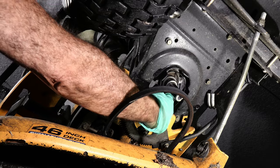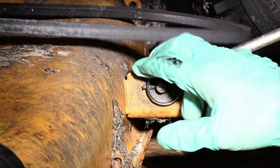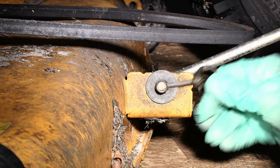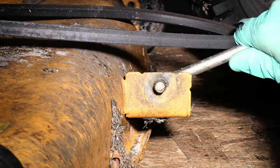As you can see, I think we're going to need a new belt. I got the mower back down. Now you're going to want to make sure your deck is all the way down so that the wheels are pretty much touching the ground if they'll go that far, and just remove this bar that's in the front — that's the one I thought was going to be in the way.